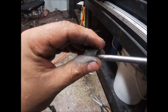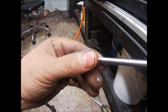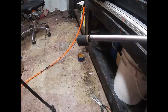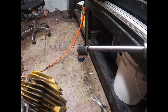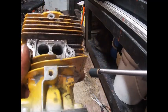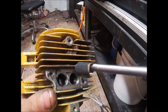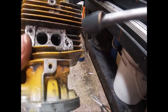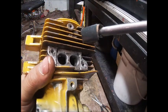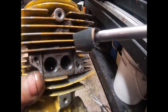Okay guys, so I've changed out the bit in my handpiece. What this is, is a piece of sandpaper. It's 500 grit, wet or dry. I've got it and the port hosed down with WD-40 or a Great Value penetrating lubricant from Walmart. Same thing I guess, but just a lot cheaper. What this is going to do is polish and at the same time maybe knock down any imperfections that we may have missed.